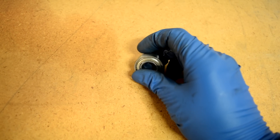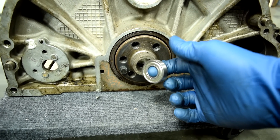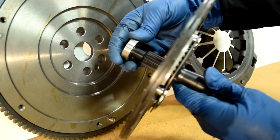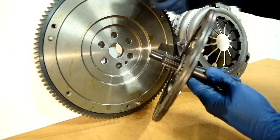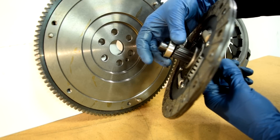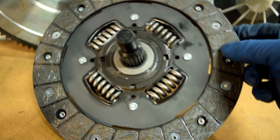Before I forget, there's one more component — the pilot bearing. Your clutch pilot bearing sits inside of your crankshaft, so when it's seated there, the outer race moves and turns with the speed of the crankshaft, while the inner race is connected to the tip of the input shaft and turns with the speed of the input shaft. When your clutch is engaged, everything is spinning together, so that's not a problem. But when it's disengaged, it allows the crankshaft and your input shaft to turn at different speeds. Also, these springs on your clutch disc are there to dampen the vibration you get from engaging and disengaging your clutch.